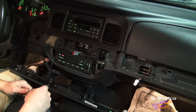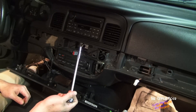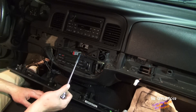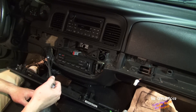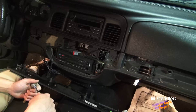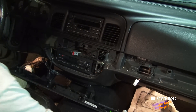From the mid to late 90s, these seemed to be pretty reliable units, but from 2000s and up it seemed like they got cheap on the O-rings and the solenoid. What you saw was a block of metal before — now it's just a piece of plastic, which actually means you can rebuild them. All I was reading was failures on these — failure after failure — and it was because of the O-rings. Get yourself a good set of O-rings. I would recommend McMaster-Carr O-rings, but O'Reilly's will be okay. They didn't have the Fel-Pros I wanted to get, but you can't win them all.